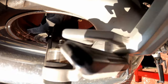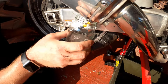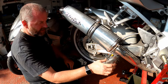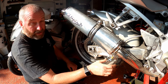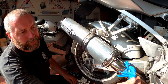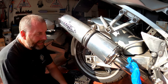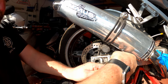I've got my little jar to capture it all so we're not going to have brake fluid dripping everywhere. I'm going to allow this all to drain out and then we'll look at getting the caliper off. I've just popped a rubber glove over the end of the hose with a little tie wrap and any dripping fluid will just be captured in there and I can dispose of that later on. Now I'm going to remove the caliper from the bike.